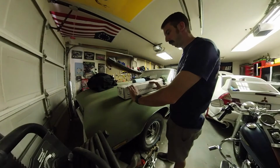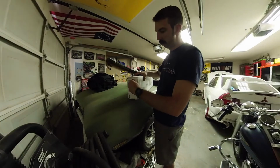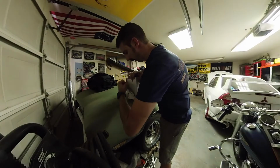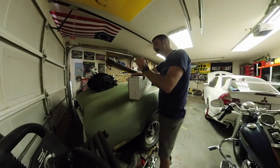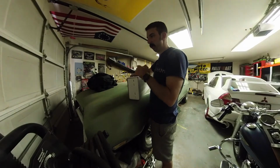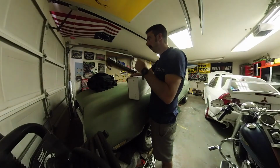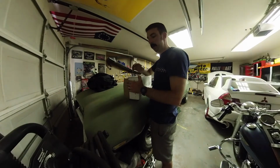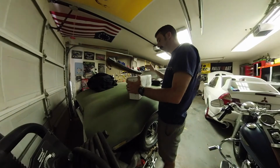Anyway, so these right here are the slash cuts with the 2-inch baffles. You have your option of baffles, 1.5 being the quietest, just a little bit louder than stock, then 1.75 inch, 2-inch kind of being the sweet spot as far as being loud, but still not messing up your tune if you don't want to tune it. 1.75, they said for sure you don't need to worry about tuning it. 2-inch, they said yeah, you're good. If you go above that, 2 1/4, you have to get it tuned, they say. So I plan on getting it tuned soon anyway when I do an intake. But for now, I wanted something I could just put on and run it.